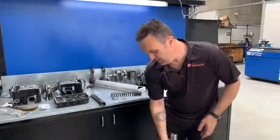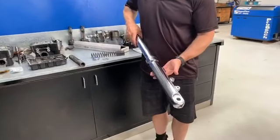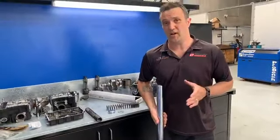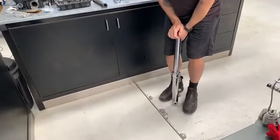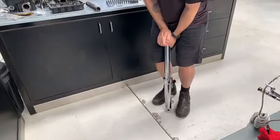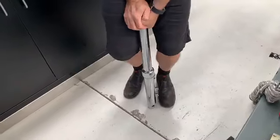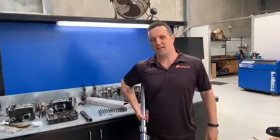So quite often we get, this bike's just had a set of, it's a V-rod shock, it's had a straight rate spring put in it, and it's all our oils, it's set up like we're racing a bike. It's gonna handle really well, and then when the pressure's on or it's coming in a corner or you're braking, this shock has a lot more control over it. This is progressive. Not progressive springs, but in the action and how it loads up and pressures in the forks there. There's a lot more to it, but basic shops don't understand this.